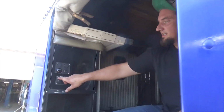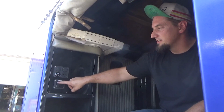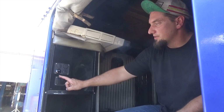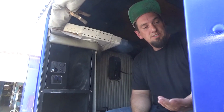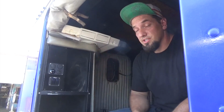Yeah, and then the sad thing is, I might have to figure it out, but the light on this switch doesn't light up because we're ground side switched on this. And so this just gives ground to the relay. The benefit of doing that is that you can have multiple switches so that we could add other areas that he could add another switch. It works kind of like your dome light setup. And that's that super smart stuff I'm talking about that he does.